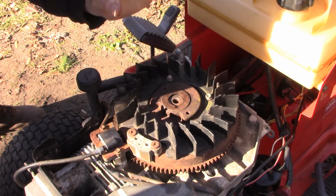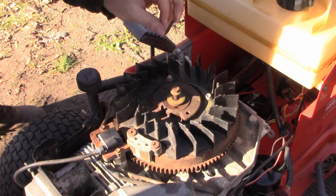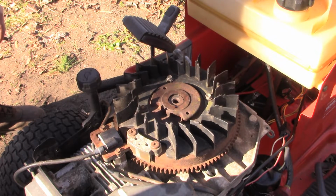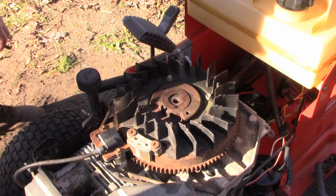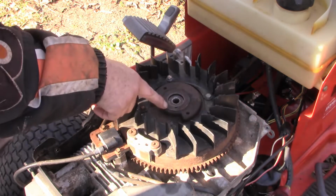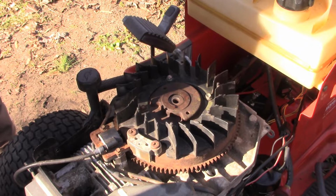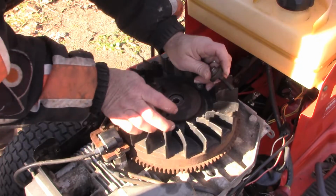Now this is a tapered shaft. It gets wider as it goes down, and it's the tightening of this bolt that secures it in place. It's not really the pin. The pin is there to make sure it's lined up properly, but that pin is designed to shear away in the event of a jolt, to protect the motor. My wife referred to it as a wear item. It's not really a wear item, but it is a safety item, a stopgap measure, if you will, to protect the engine in case of a jolt. I'm hoping that this is going to fix it for us.